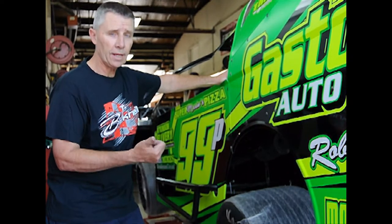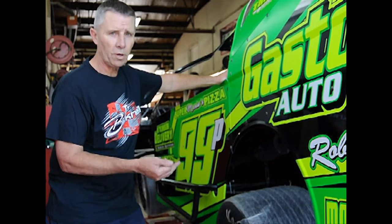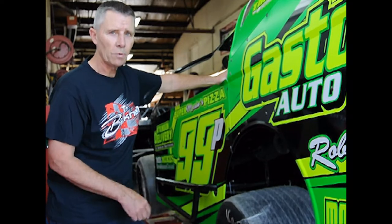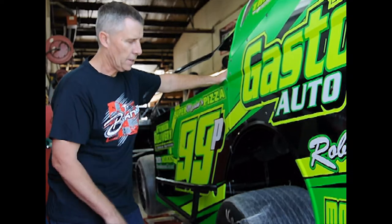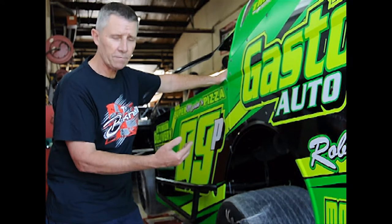To achieve that, we need to make sure the car is race ready with the proper wheels on it. We run a 10.4 left front, 12.5 right front. On the rear, we run a 13-inch by 3-inch backset on the left rear and a 14-inch by 3-inch backset on the right rear.